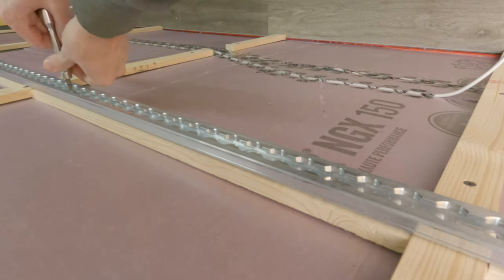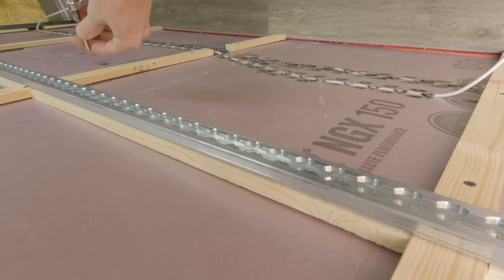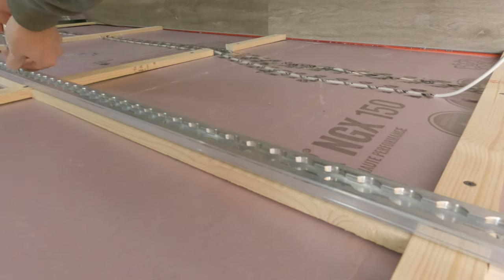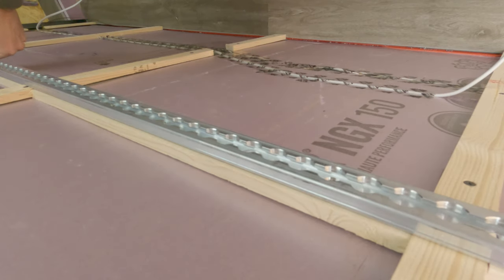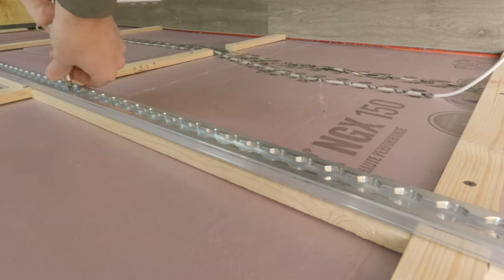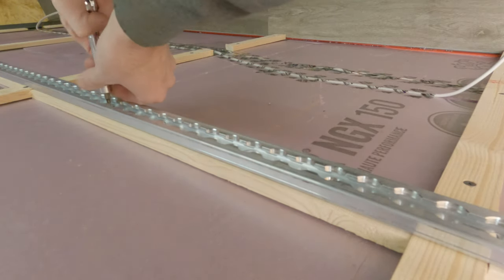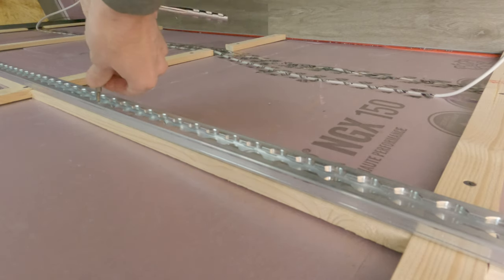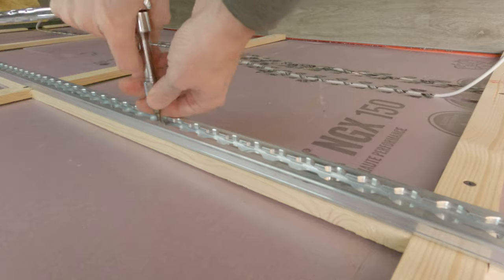So I put all these screws in. They're a 1.5 inch stainless quarter 20 with a hex head as the driver. I was really surprised at how sturdy this all became and actually how much it strengthened up the side of the trailer once it was all in place.